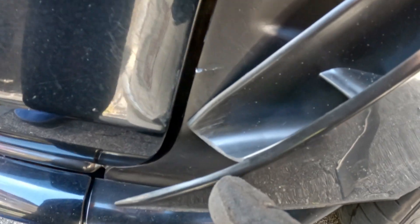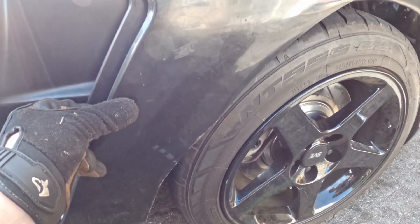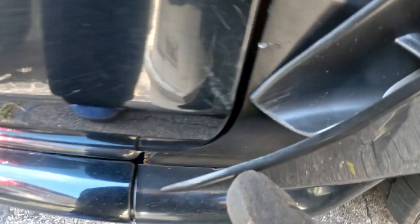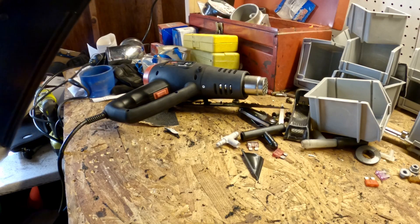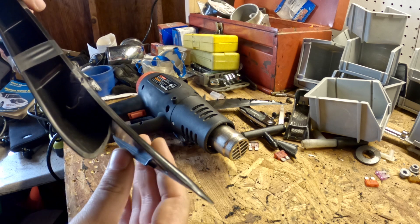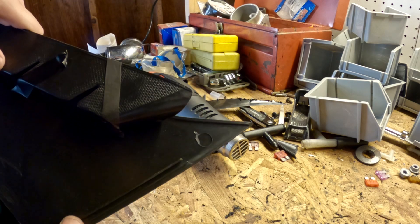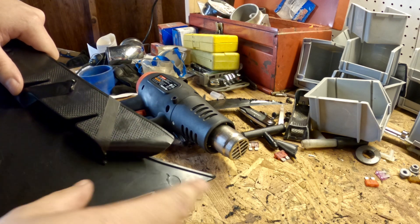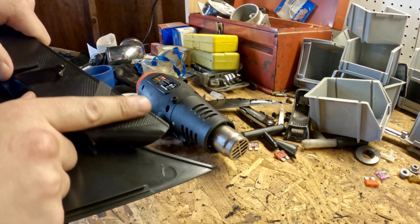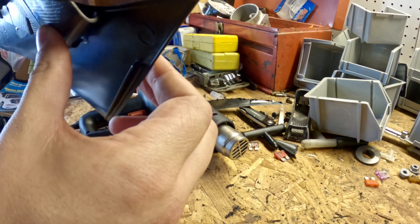Things are a lot better, but I still have to take care of this piece here. What I think I will do — the beautiful thing about plastic is a little heat and you can make it do things it normally wouldn't do. So I'll get this kind of temporarily placed and then get my heat gun and see if we can bend that piece in, taper it in. I've got the heat gun and I've got this all taped together for now. It will be glued together at some point, but I hope if I heat the back of this up I'll be able to roll it around this curve here, so it'll sit flush against the body instead of just being an open gap. That is what I'm hoping happens.